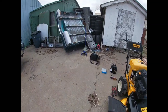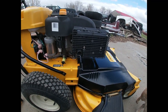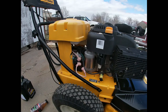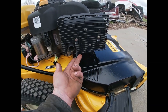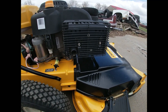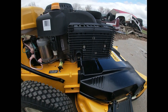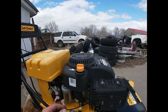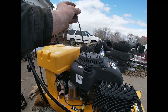I got it for $200, and the big thing I wanted to see when I bought it was of course this, which confirms that this thing has probably never seen grass just like he said. The hope is that we can get it freed up and sell it since this is a spendy mower brand new. First thing I noticed was the residue here, which I thought might indicate that it had hydro-locked — a stuck float in the carburetor. But I don't believe that to be the case because when I pulled the dipstick, there was next to no oil on it.